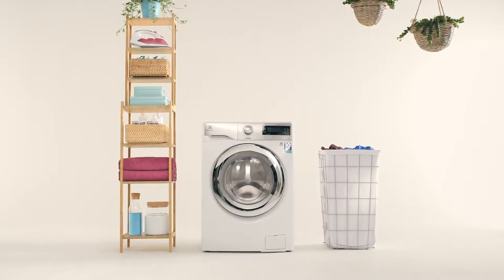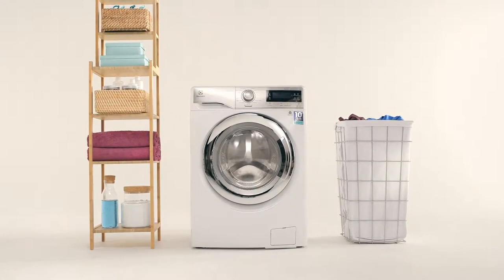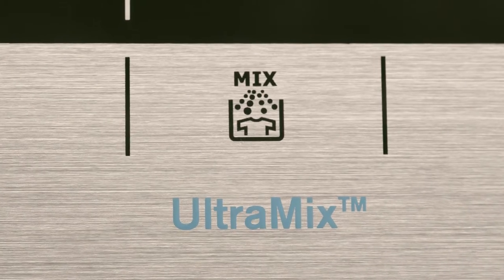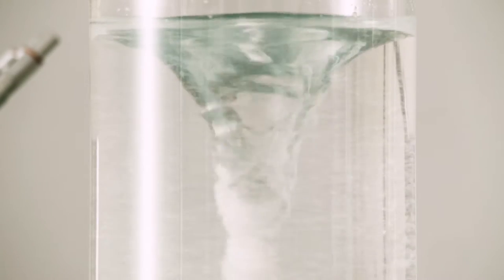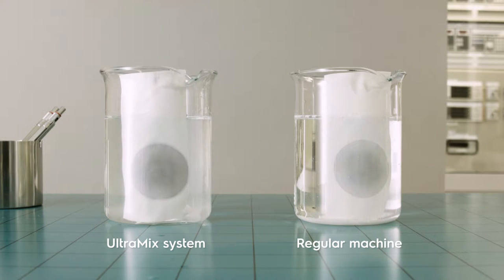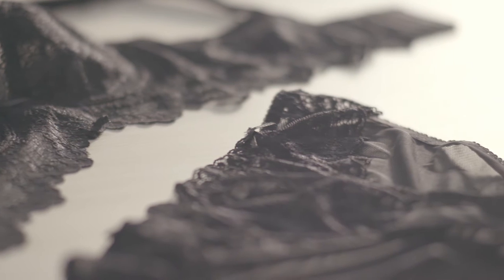With a new Electrolux washing machine, you can say goodbye to hand washing even your most delicate items. To ensure a gentle wash, Electrolux introduces its Ultramix technology that is automatically activated on most washing cycles. The Ultramix system premixes the detergent with the water before spraying it into the drum, making the detergent completely dissolved and much more effective even at low temperatures. So it's gentler on fibers.